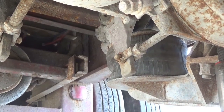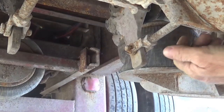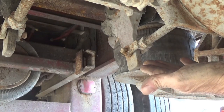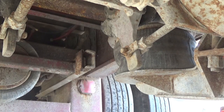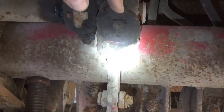Using an impact — you've got to be careful you don't pull this thing back too far because you can break it. I just did a few more turns, maybe 10 more threads after it. When I saw the slack adjuster stop moving I didn't want to keep going because I could tear up the inside of this brake chamber. I learned a new trick — I'm holding the flashlight and the camera at the same time.